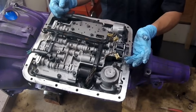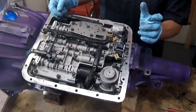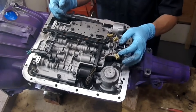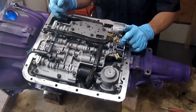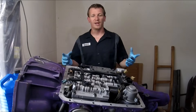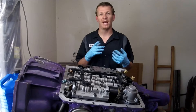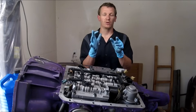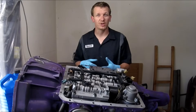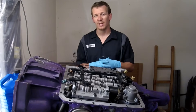That's it for shift solenoids A and B. Make sure you check your wiring harness for ground — it's a quick, easy check; it doesn't mean the harness is completely good, but it's a good relative check. If you do have ground, check the shift solenoids with your 9-volt battery. That should answer a lot of the questions that have been asked. Remember to like, subscribe, and share. If I missed anything or didn't answer your question, ask below in the comments.